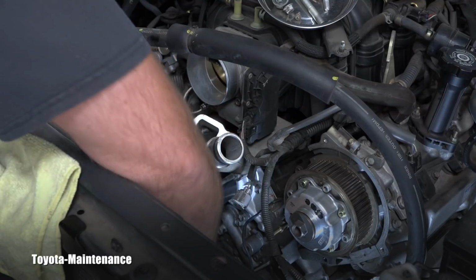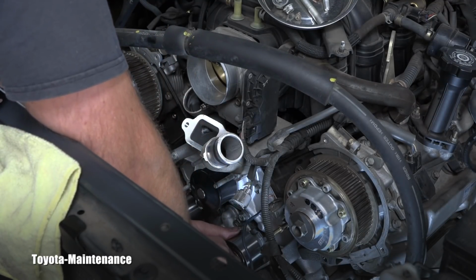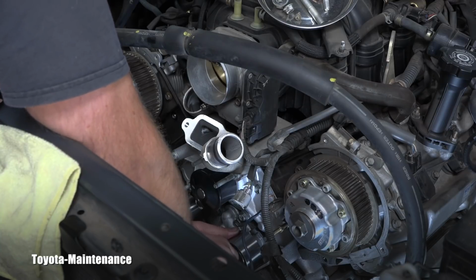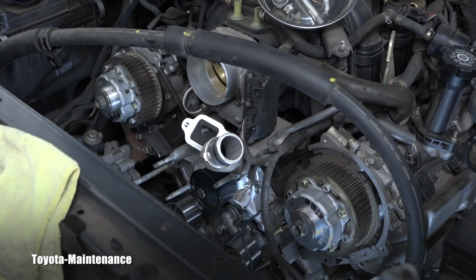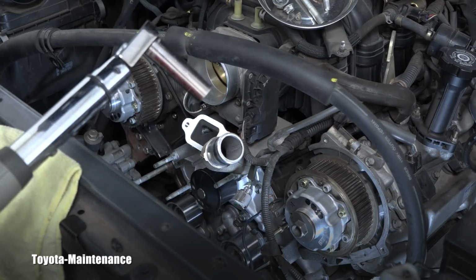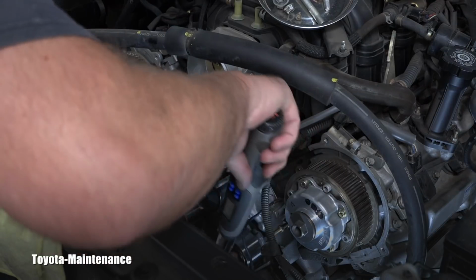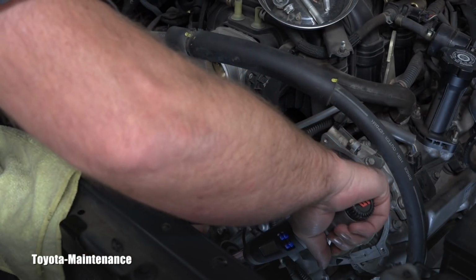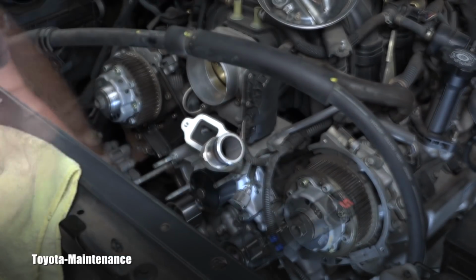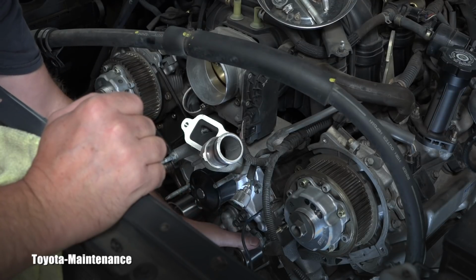Here is the replacement number 2 idler pulley. Alright. So I can start installing that, and this one doesn't have any spacer or washer in the back. And this will be the same 35 Newton meters. To tighten that, you need the 14 millimeter socket. So again, 35, right? I said. Nice. And again, of course, you will check that it's perfectly freely spinning and there's no play.